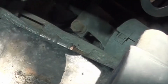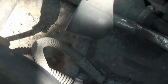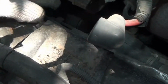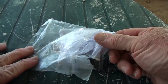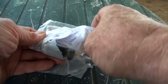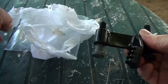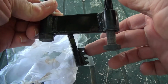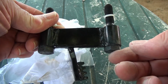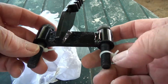Okay, right down in there is a bolt. You can probably see that. That is connecting the steering shaft to the steering rack. If you're replacing your damper pulley, if you have an automatic, you need to take the starter out and lock the flywheel. And that's what this tool is for here. So this is a specialty tool. What it does, screws up where the starter goes, and then these teeth here catch the flywheel. So now let's get the starter out. This is supposed to work. I will find out.